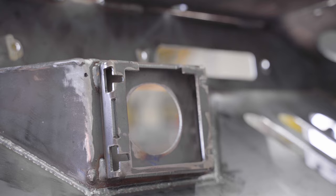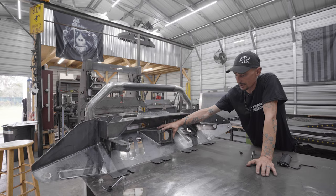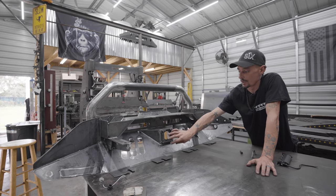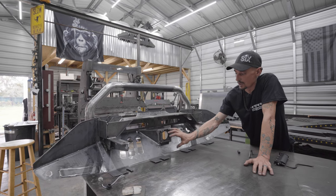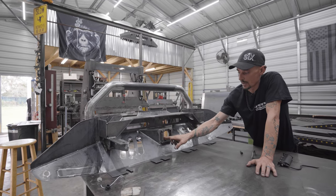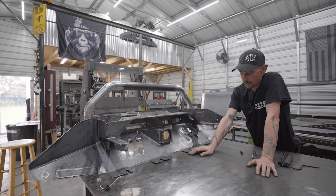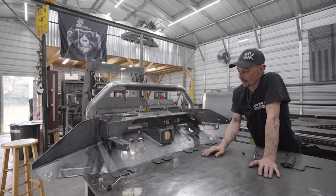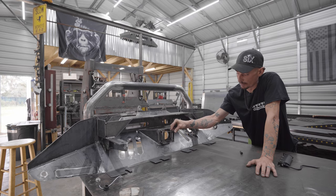This particular one has an ACC, so it has an ACC mount on the inside. You'll remove your ACC from your factory fascia, insert small carriage bolts, and your ACC will fit in there. You bolt it in and it'll sit up against its face — your ACC will be on the inside. There are two different mount patterns: a small bolt pattern and a big bolt pattern. This is for the big bolt pattern. If you have a small bolt pattern, you'll use the sub bracket we supply and it pinches it in.